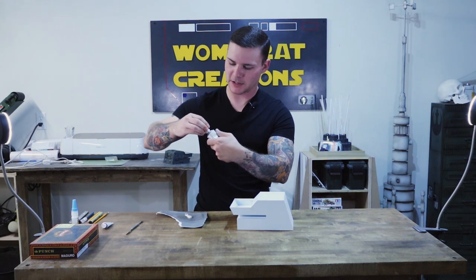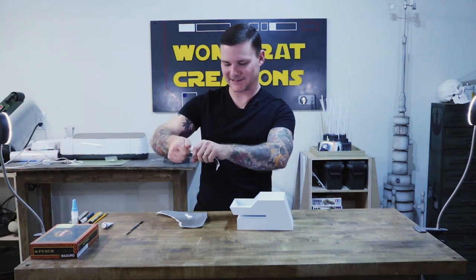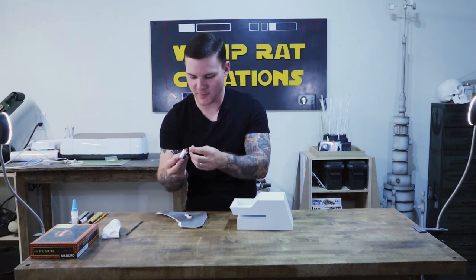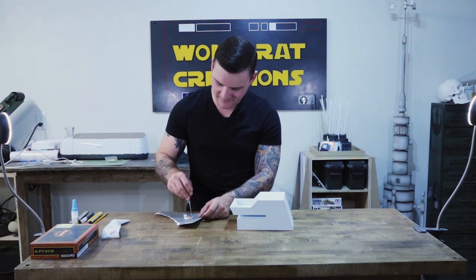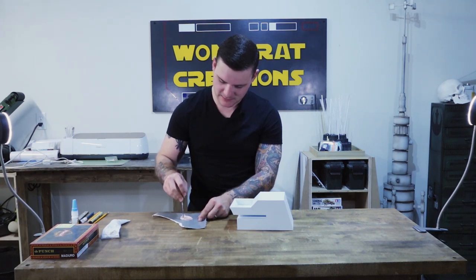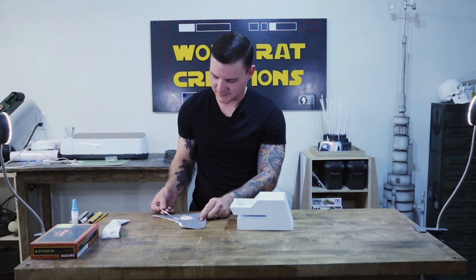And yes, I'm still working through this two-part spot putty, and still not a fan. I really miss my one-part spot putty. Oh man, that was a lot of hardener. That's gonna kick really fast. Exactly why I don't like the cream hardener. Or, I'm sorry, the two-part spot putty. It's too hard for me to get just a small amount of the hardener and not just dump a ton on there.